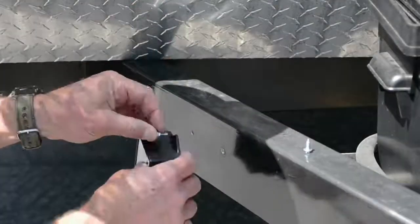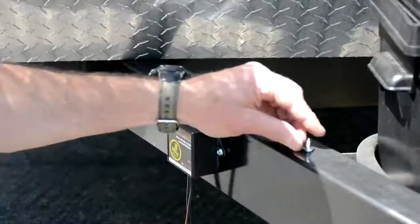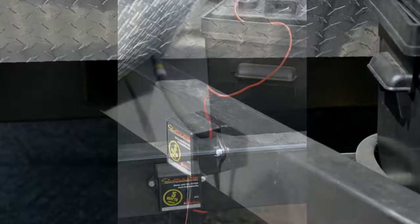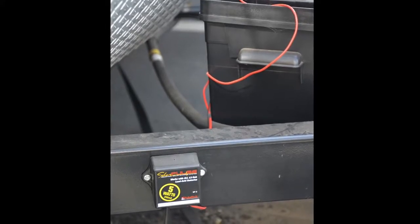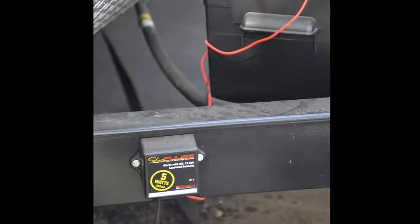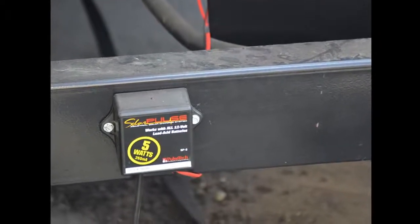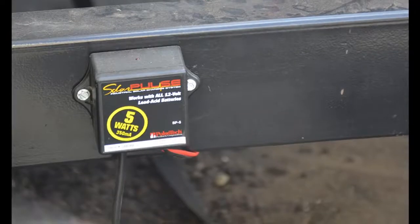Install the circuit box first. The circuit box is the brains of the Solar Pulse system, and Pulse Tech's website describes this technology as a patented high frequency pulse waveform that charges the batteries and also prevents and eliminates battery sulfation — the buildup of lead sulfate crystals on the plates that will eventually prevent a battery from accepting and releasing power. I chose to drill two one-eighth inch holes in the A-frame near where I have batteries mounted and attach the controller with a couple of number eight sheet metal screws. The controller comes with about three feet of battery cable wire, so you have some flexibility on where to mount it in proximity to your battery setup. I wanted to put it where I could easily check the LED indicator on top of the controller box anytime I'm walking away from or visiting the trailer in storage.